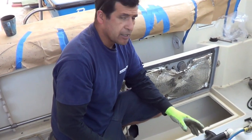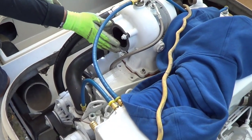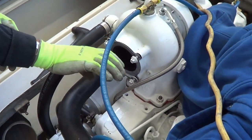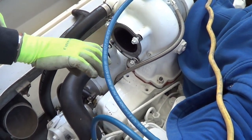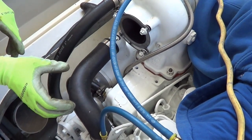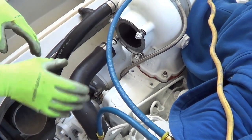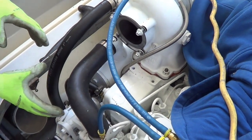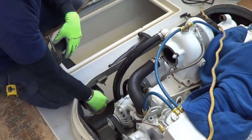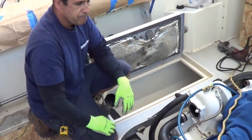The next step — we're going to get a flange, a custom Seaboard Marine flange, and then we're going to get a 3-inch pipe that we cut at a certain angle, and then we get a 3-inch 90, and then we're going to cut a bell — a 5-inch bell — so it's going to go from 3 to 5. Then we're going to adapt to this fiberglass tubing inside right next to this alternator. That'll be the next step.